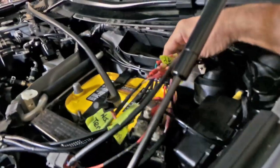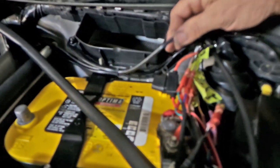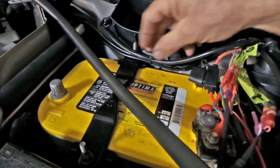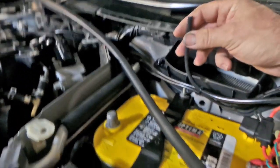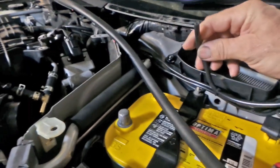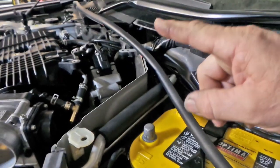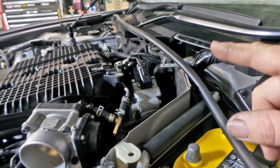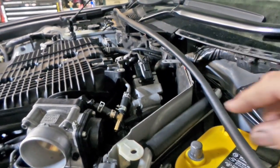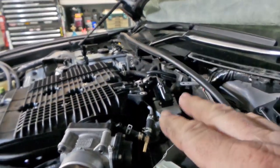It all runs back through that waterproof boat deck connector thing here that I showed you right in the early stages of disconnecting everything. There's only one vacuum line currently coming out of the vehicle. That's all I need. That's this little guy here. And that just runs back into the boost controller handset and also into my boost vacuum controller for my PLX gauges. Other than that, that's my only boost reference for inside. Obviously, there's lots of other silicon vacuum hoses running boost stuff coming out of the back of the engine there for wastegates, boost control, blow-off valves, etc.